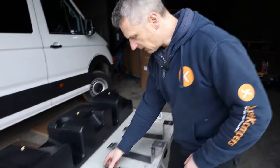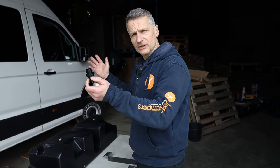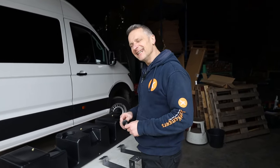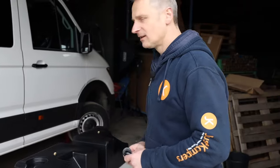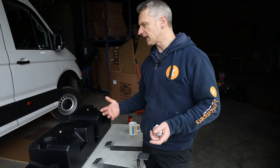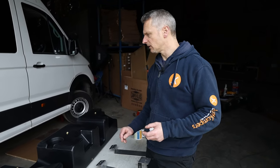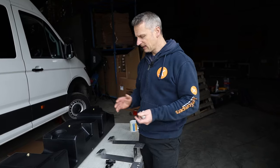The first thing is to dry fit it — pop it under the van, see how it slots in, and work out where we're going to drill and put our brackets. We tried to get it underneath without jacking it up but it didn't work, so we've jacked the van up and got our lying-down mats ready. Make sure your axle stands are nice and safe on flat ground.